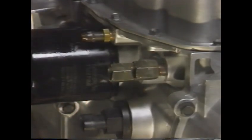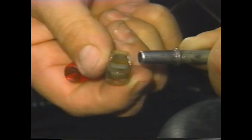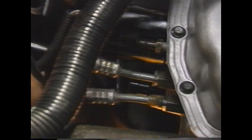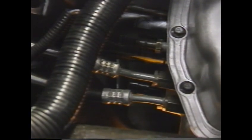the upper line. Use a screwdriver to lift the fastener center of the front splash shield, then remove the shield. Remove the transaxle fitting connector from each line by using a small screwdriver to pry the tabs away from the rib on the line. Inspect the transaxle fittings and retainers for wear or damage and replace them if necessary. Installing the cooler lines is simply the reverse of the removal process. Be sure to install the retainers into the cooler line connectors or onto the lines before connecting the lines.